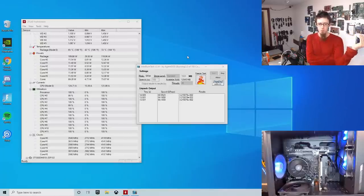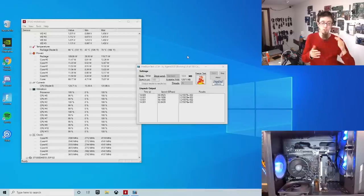The first thing I would recommend is a BIOS update on the motherboard, which is probably what I will do on this, because a newer BIOS should theoretically improve things. If nothing else, it will have newer AGESA and stuff like that, which is all of the AMD software they've put into the BIOSes. With a bit of luck, Gigabyte will have also done a little bit of fine tuning, and it might be enough to tweak the way memory is handled so that XMP is actually working properly.